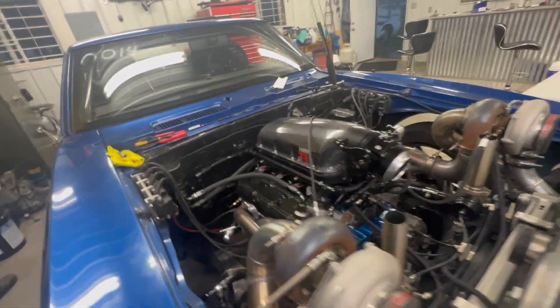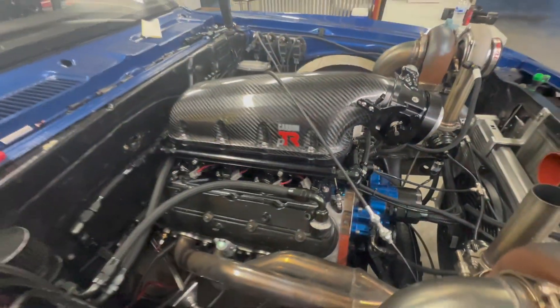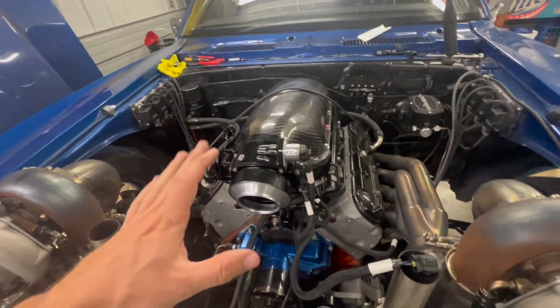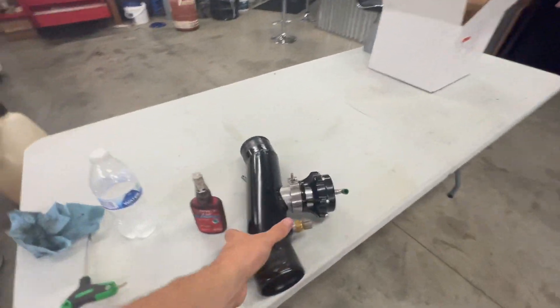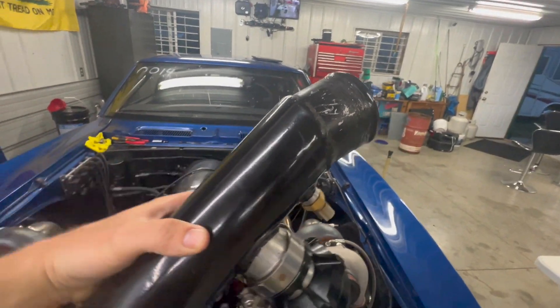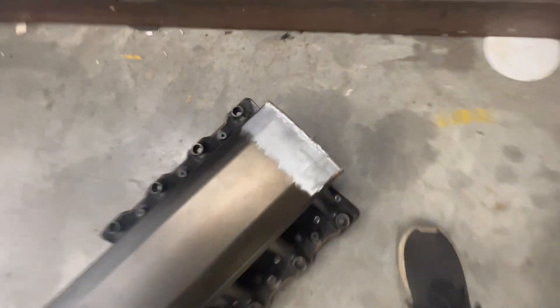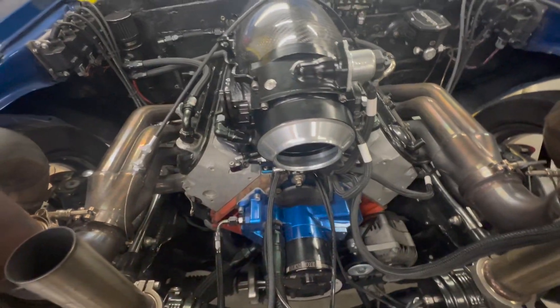Got carried away and now the intake is done, the feed fuel lines are done, and the fuel line going to the regulator and the rails are done. The intake is tied down, got the bracket and throttle cable bracket on there, everything hooked up. Now I basically need to cut this pipe — this one sits a little higher so I need to cut that angle off and weld an extension onto it to go right into that flange. About to test out my aluminum welding skills again.